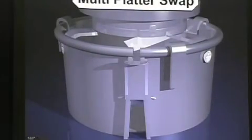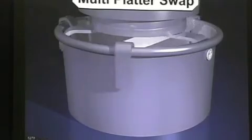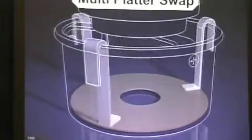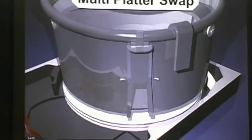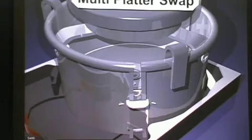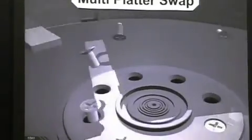For multi-platter drives, there is a special tool. This tool looks a lot like a coffee can — very thin metal — and it has a V-shape on the right-hand side. There's a little cap inside that keeps screws from floating around on top of the top platter. You take this tool, disassemble everything around the sides of your platter, then slide it over your three or four platters — I've done up to four — keeping them all aligned. The V-shape creates pressure when you push down, which allows you to take out the screws inside and they'll just sit on top of the lid of the tool.